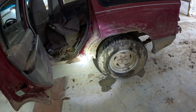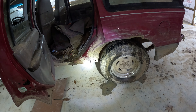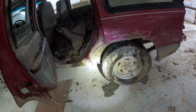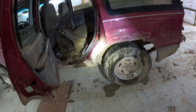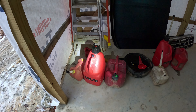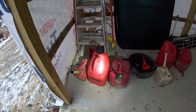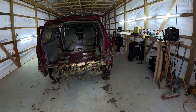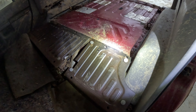From what I can tell, our fuel leak is from the tank. It leaks when it's not running, it's a very slow leak, and it doesn't seem to matter if it has pressure or not — so I'm calling it a tank leak. But what I'm not going to do is buy a new fuel tank for this crusty old explorer. We're gonna have to figure something out on this level. I live my life five gallons at a time, guys.